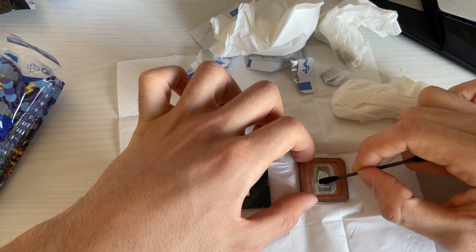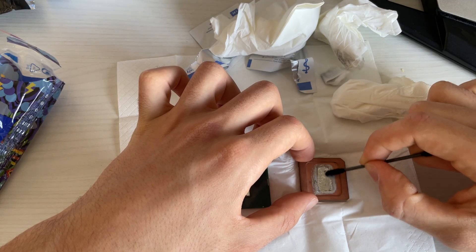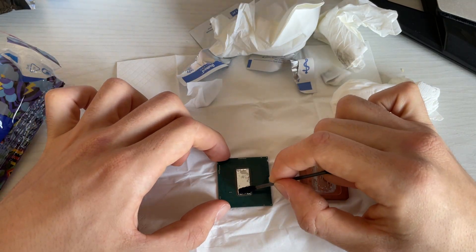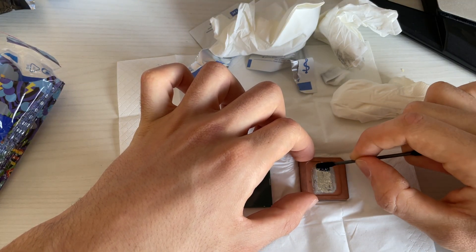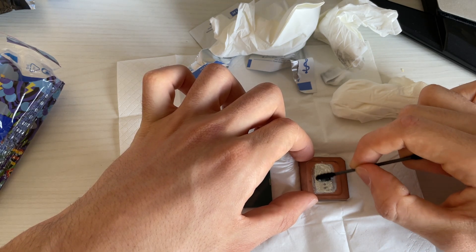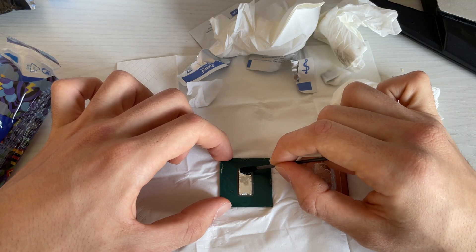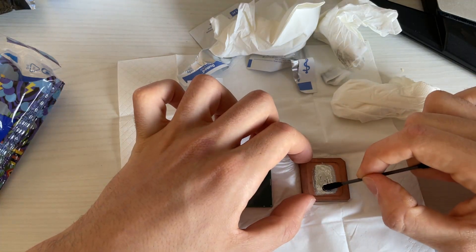Now I'll do the same on the IHS with the leftover liquid metal. I have the exact footprint of the die, so I can just place it right over there. If you don't have the footprint, just do what I did previously — apply it around the border. You can't really put too much on the IHS since we have nail polish on it, so it won't be a big deal. Spread it multiple times to make sure liquid metal is everywhere and sticking properly — that sticking part is the hardest.